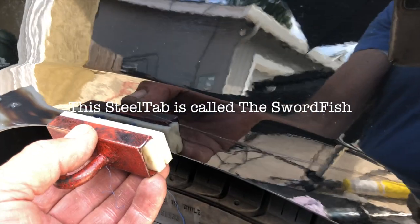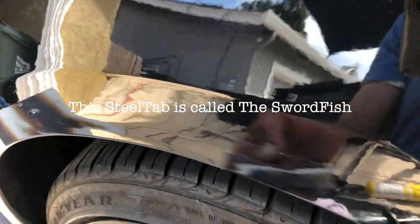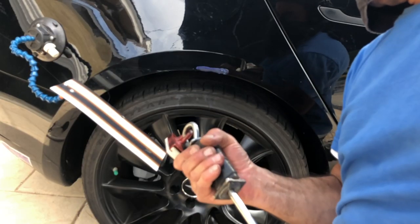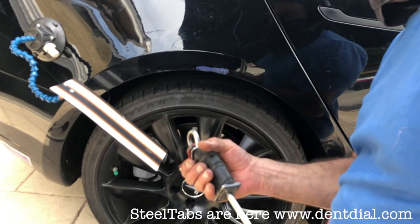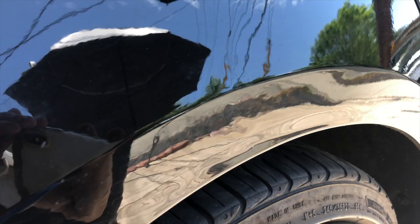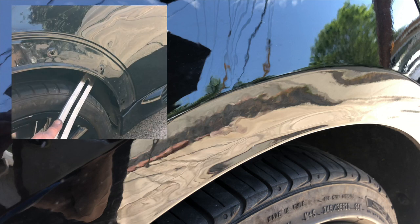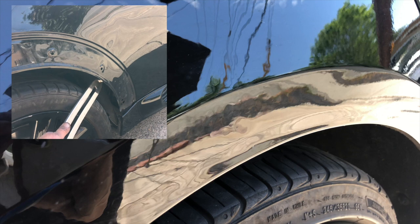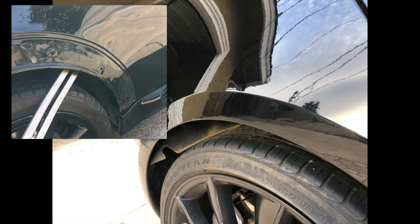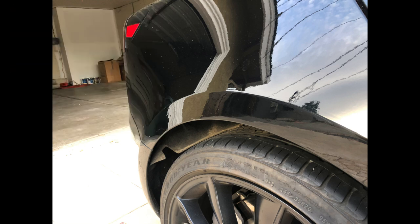This edge right here I've been saving until the end. I'm going to get my big steel tab on there and just start pulling out that edge to see if it comes out. Once again, I love glue pulling, but it only takes you so far. In this case, trying to lift out a curl on the edge of double metal — not going to happen. Even with the best glue pulling equipment, I simply pulled out my dent dial, my 35 heavy, and got right in that double metal and pushed it out, no problem. Just like the Mini Cooper I did — did the same thing here, just curled it right back out.